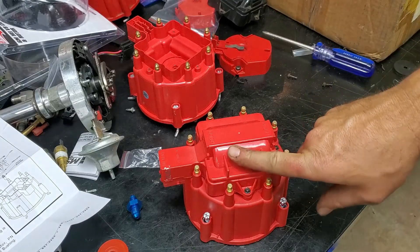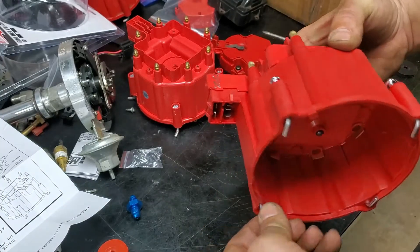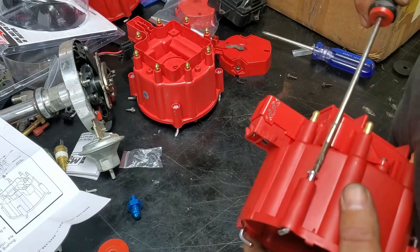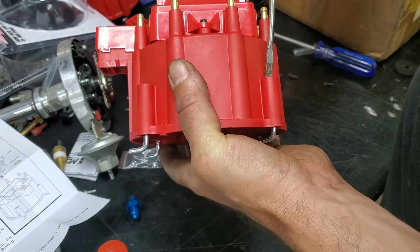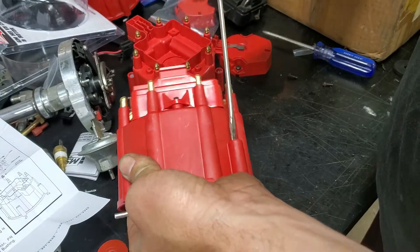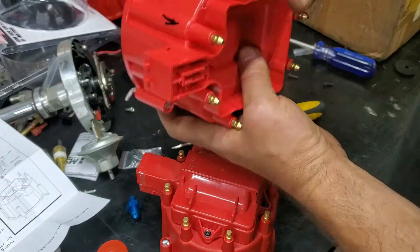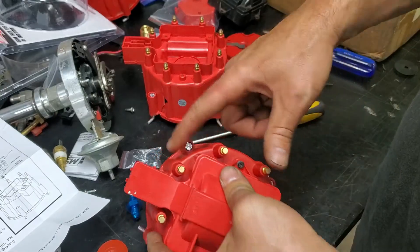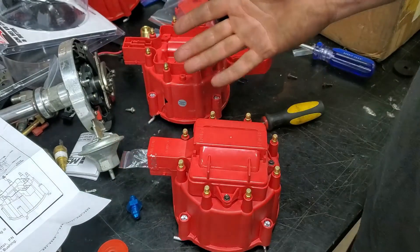There we go — now it's ready to be reinstalled on the car. Just remember those J-hooks: it's the same way that you took it off. You're going to want to take your screwdriver ahead of time and kind of pre-lock these out of the way so you can get it down on there easier. Now they're all out of the way, you can slide it down there. Don't forget your little key. Look at your distributor and you can see that number one is right after the coil connection, so you know that's where you're going to start wiring your spark plug wires. Mount it, push those down, go ahead and put your plugs in, don't forget your wiring, and then you're good to go.